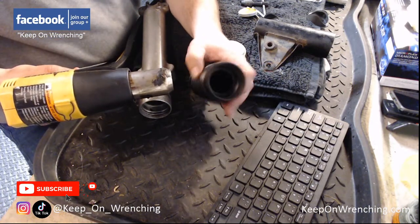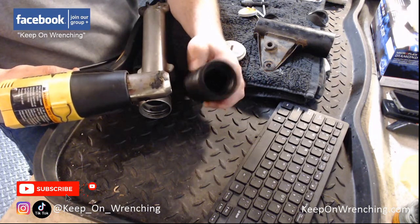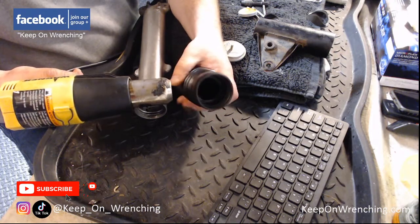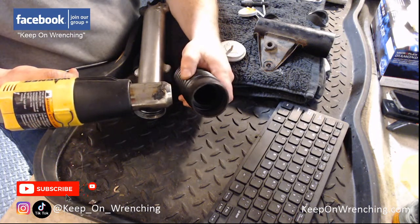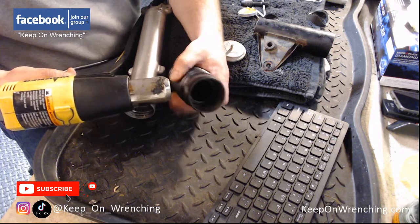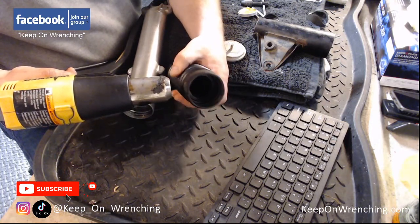I can't do it while it's on the bike, and you can't mount it before because of the ears. Totally. It kind of has to be on the bike. One thing you might try would be to take a flat screwdriver and get it on one end, then get the other end going, and then work that screwdriver around, all right?